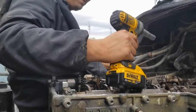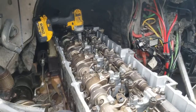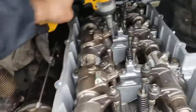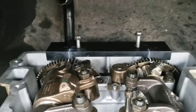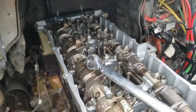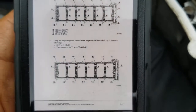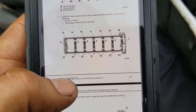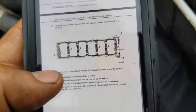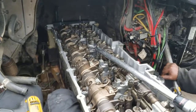We're going to go back and tighten them all with a torque wrench. I've snugged every single one of those bolts and checked the cam timing marks to make sure it's sitting on there properly. The last step is to torque these bolts to spec — here is the correct pattern for tightening the cam housing bolts: 15 foot-pounds on the first step, and then 37 to 40 foot-pounds on the second step. Then we'll go ahead and do the overhead.